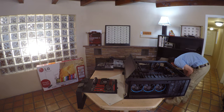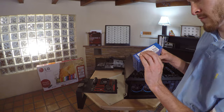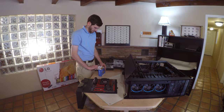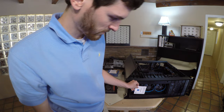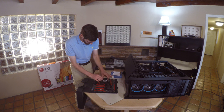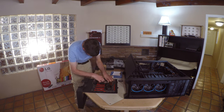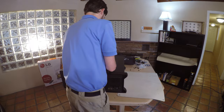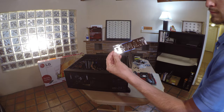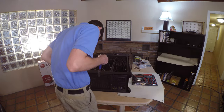After verifying all the components and checking the motherboard, now we install our i7 processor. Verify the processor is intact, take it out of its packaging, and take the sticker and set it aside for later. Carefully remove the CPU cover, and then install your CPU into its socket accordingly. This is your backplate. Use this backplate to install on the computer before you mount the motherboard.